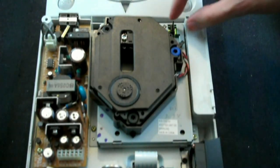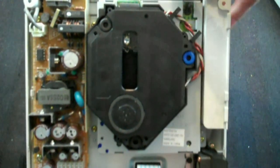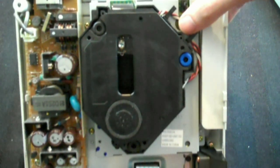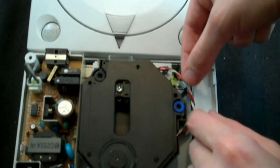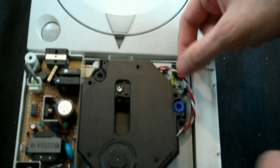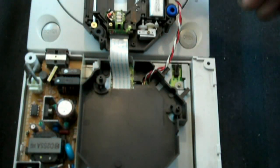Over here you'll see there's a couple of wires right there, and then there's these black plastic clips there. You have to get those out from under there and put them on top. I'm not going to do that on camera, but be very, very careful — you do not want to tear these things. The easiest way is to start with this one: just lift up the black plastic tab a little bit and wedge this out. The same goes for the other side, but do this one second. Then just lift it over — you'll need that extra slack — and then pull this up. There are no screws holding this together, so you just pull it up over like that.